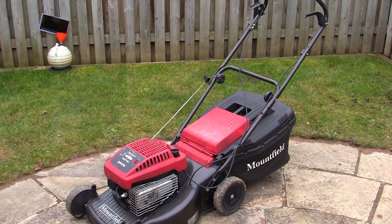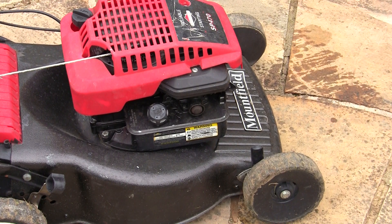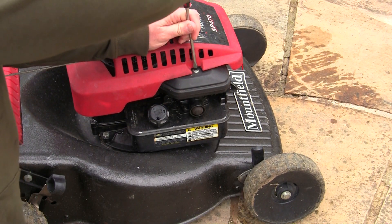So you get the general idea — it's running alright, it's my own lawnmower. Let's quickly take off this carb, tank, diaphragm, and gasket, swap it for two diaphragms, and see what we get. Let's quickly whip off this tank and take the air filter off. I'm going to leave this cover on and take this off.